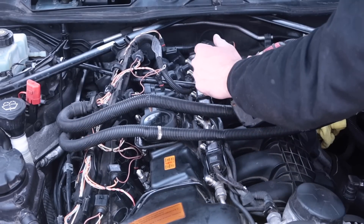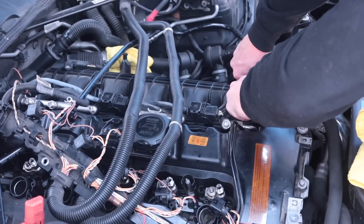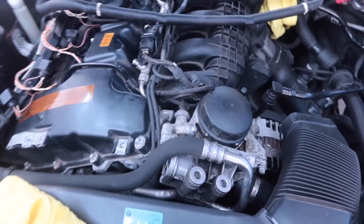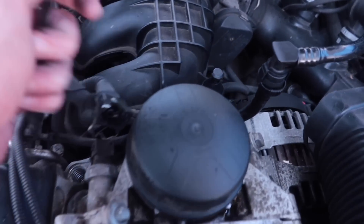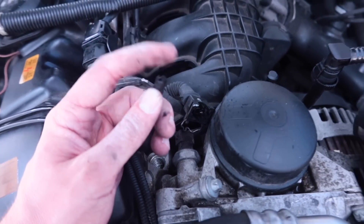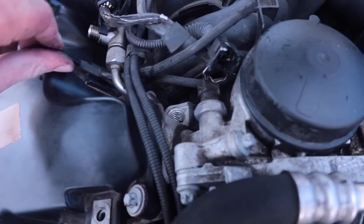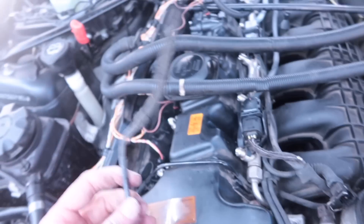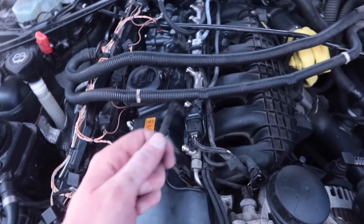Once those were off, it was time to whiz off the fuel rail. Next up were the two vacuum lines that run across the top of the engine. Problem number one: I've just snapped one of these vacuum lines. Hopefully I might be able to find a replacement — it's bank holiday tomorrow, but hopefully it's just a generic pipe and I can still find one. Fingers crossed, but yeah, not ideal.